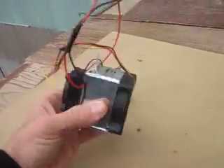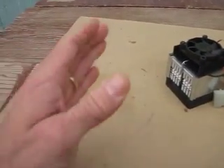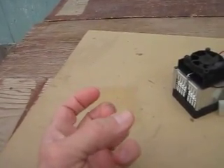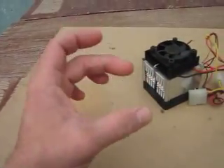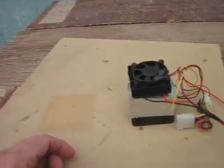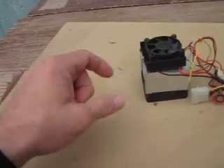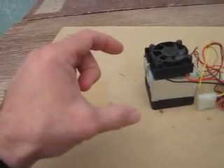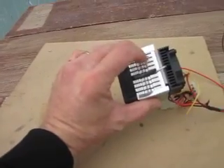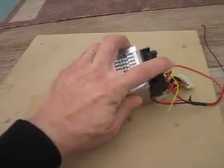Here's another idea: my heater is broken, so here's the idea — take the pipe, cut it, make an aluminum sleeve. Any machine shop can do this. Make an aluminum sleeve where the two ends that you cut fit into this aluminum sleeve, and it has a flat side that is the size of the peltier. This has to be done just after the catalytic converter, else you won't pass emissions anymore, because the temperature has a lot to do with it. The pipe is still sealed — it transfers heat through. This side is the aluminum bushing fitting, and this goes into the cab of the car.